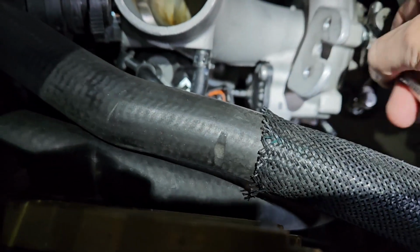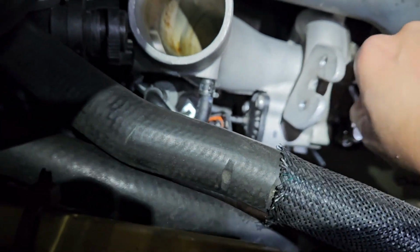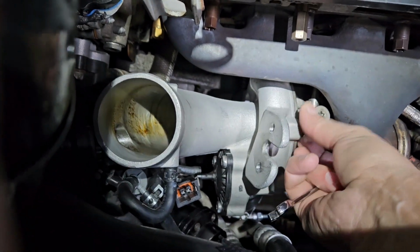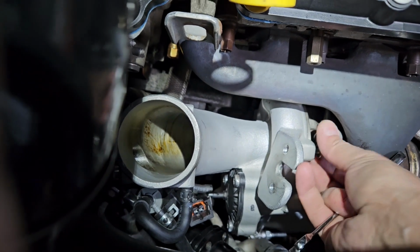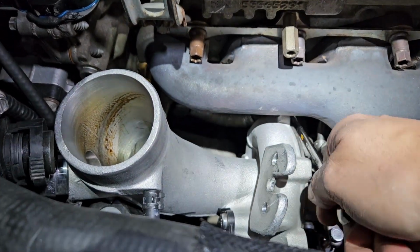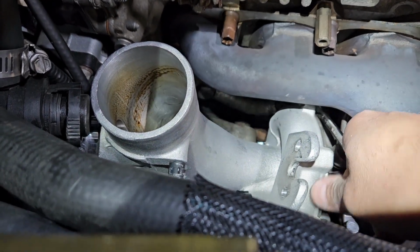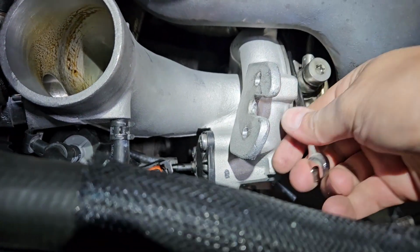This one comes all the way out, this top one right here. Once you get them loose, you can start taking them out with your fingers. Okay. This one in here, down. That's why you need the oil feed loose. A ratcheting wrench will save you a ton of time. So that's why you need the oil feed loose, so you can ratchet this thing out.